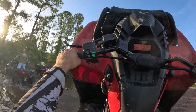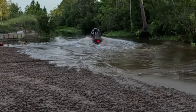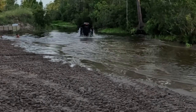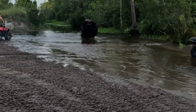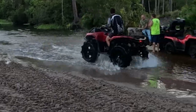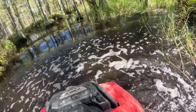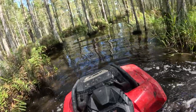I hadn't had a quad in a while and I was really enjoying the water relays and getting the balance point down, and then I decided to start doing reverse water relays right here. Yeah, so the whole pod was completely under there. Both snorkels had a little bit of water in the air box and in the belt box, but really not enough to hurt anything. The shielding is designed really well. That being said, I do want to raise the snorkels up so I can mess around and do stuff like that.